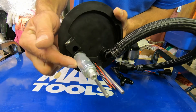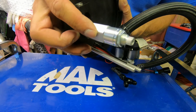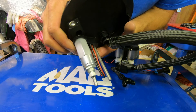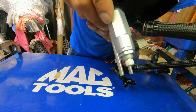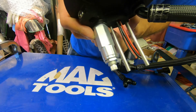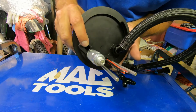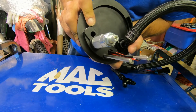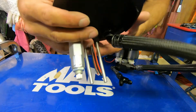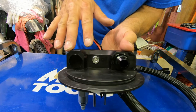We have a pressure relief valve — fuel pressure relief set at 100 PSI. It's another Parker valve, very well made with hardened tool-steel seats for the poppets. At 100 PSI it dumps right through this hole here, back down into the bucket if you encounter a situation where you're breaking 100 PSI up top. We've also got a dash-8 return — I've got this one plugged off; it's not required with this setup. We can run this returnless.